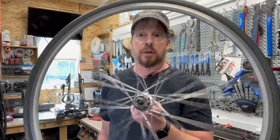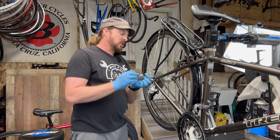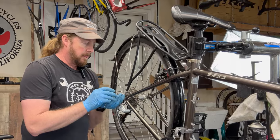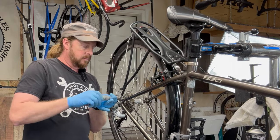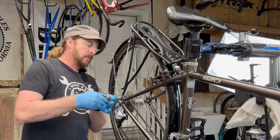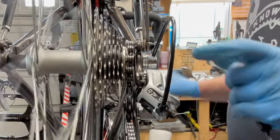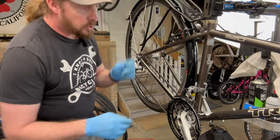Since that one was too long, I found one that might be a little shorter — just enough that it won't stick out and interfere. You're looking at maybe three to four millimeters shorter. It doesn't look like it's hardly sticking out on the other side. When I knock it down to the smallest cog it is not going to rub against the chain or get close to it — you don't want anything to catch up there. Since we have those set, now we're ready to put the rack in position.